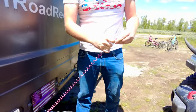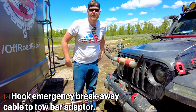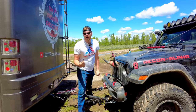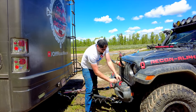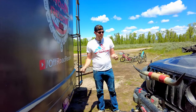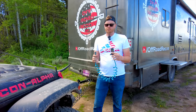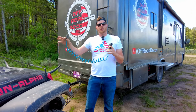This little cable here is for your emergency brake system. On the Patriot brake system there's a plug that plugs into the top of your brake system, and when this cable jerks loose it locks your brakes up on your Jeep. That's in case everything comes unhooked — your safety cables break, that chain pulls loose — it locks your brakes up on your Patriot brake system.